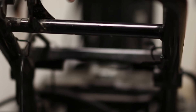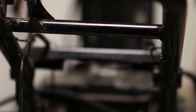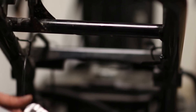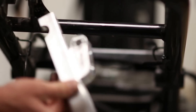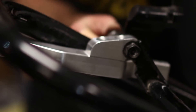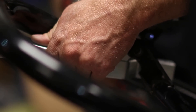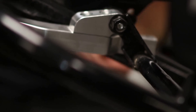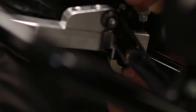We've ground off all the little tabs and painted it. The next step is to install this shock mount. As you can see, it's got the little frame cut-out here and this is where the shock goes. We're going to slide it through like this — it's kind of staying by itself right now. Now I'm just going to stick this Allen bolt through and tighten this down. This goes right where the shock would have gone. I'll keep it a little bit loose and then slide our bolts through and hand-start everything.